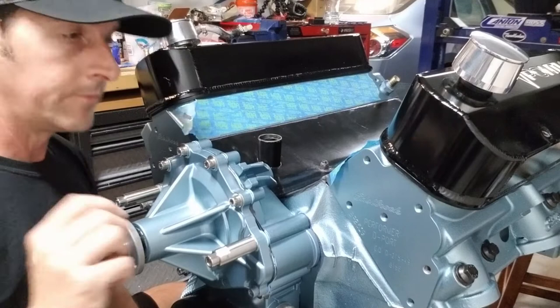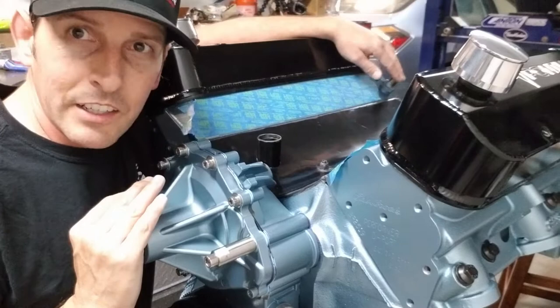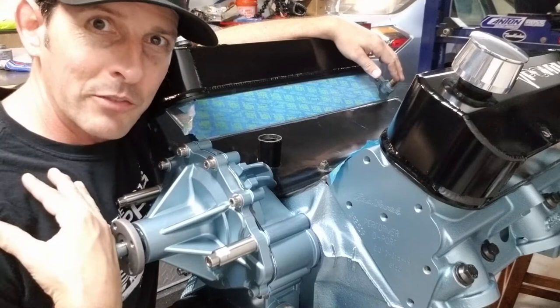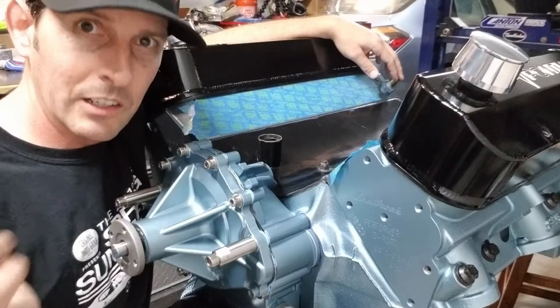Pretty efficient, but as you all know it doesn't matter what car you have — when it starts to overheat the trick is to turn on your heater. On a Pontiac engine the heater line is back here on the back of the passenger head. Now, my dad bought this car brand new and I learned to drive on it. I've experienced overheat many times, so I did not want that to happen again, which is why I upgraded the cooling system so much. I also upgraded to a serpentine belt system, which will be the next video — I'll show you how to put a March system on because I don't like throwing belts.